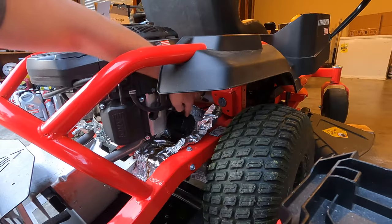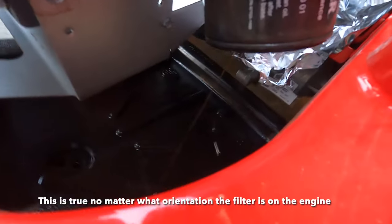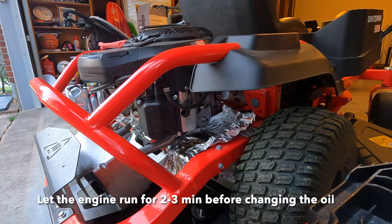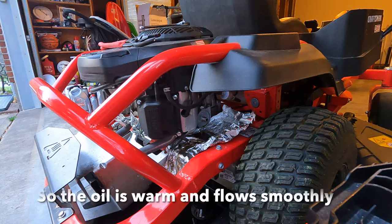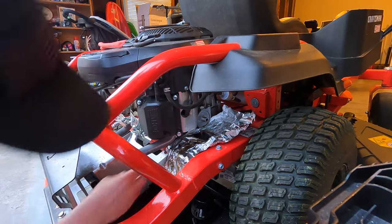You know, when you take one of these filters off, don't try and overcomplicate it. Don't grab just one, but two grocery bags, okay? Don't forget, your filter has about half full of oil too. Here's your part number, if you haven't checked the description below. It's been 3 or 4 minutes and I'm just about at the end of my dripping here, I'm thinking. So I'm just going to tip my aluminum foil and get the rest of the oil into my catch can.